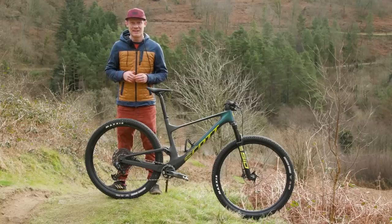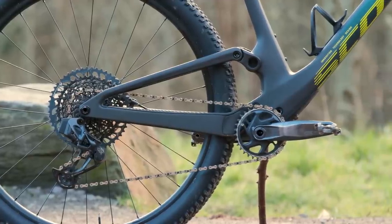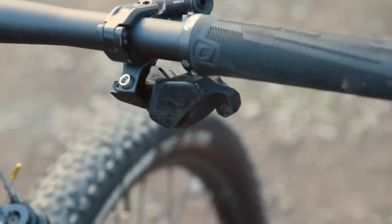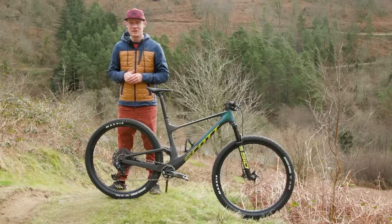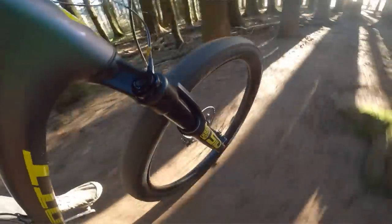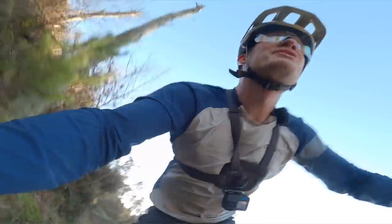The name of the bike gives away the highlight of the spec list, with SRAM's GX AXS drivetrain impressing all who test it. The wireless electronic shifting is light in feel and incredibly dependable, so long as you charge the battery — on an XC bike, it simply makes life easier when your head is down and your heart is pounding. The RockShox suspension is solid: up front there's a new SID fork with 35mm uppers in the cheaper Select build, and inside the frame is a custom nude shock built by RockShox with a trunnion construction, the smaller dimensions helping the shock fit inside the frame.